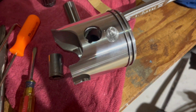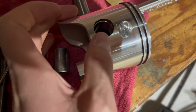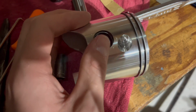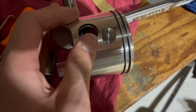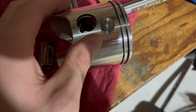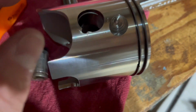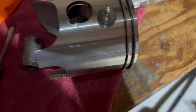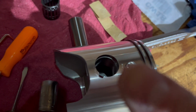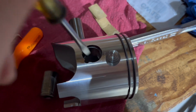And if I didn't really emphasize it enough, in the very beginning, you're rolling the circlip as much as you can with your fingers. You roll it in there, and then it kind of flattens out, and then it won't really gouge anymore because it's not like jamming into this. But you're keeping it flat with the wrist pin on the back, and you're rolling it in to get it as flat as possible, and then you're in a good spot to kind of hold it with your right finger, your right thumb, and then you can take your little screwdriver and come in and mash it down.